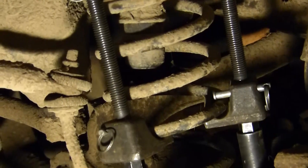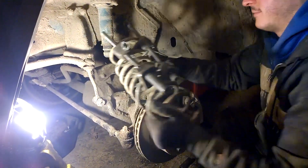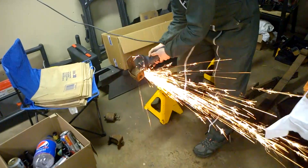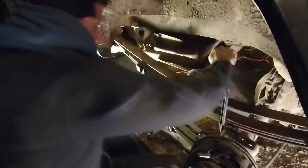The most obvious change is the new lift kit. The front was fairly simple — we just pulled out the old springs and shoved in some new stiffer springs. We got about three and a half inches up front. The back wasn't too bad either. We got some cheap Chevrolet S10 pickup truck springs off of Craigslist, cut the main eyes off and bolted it underneath the main leafs under the Cherokee.